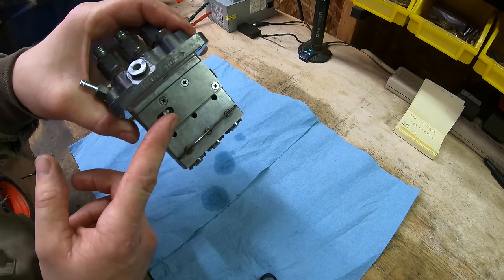When reinstalling the pump, the stop lever on the rack must engage through the notch in the solenoid bracket. The pump needs to be held down against the spring pressure of the lifters while starting the back nuts first, then the front bolts. When pushed down firmly the pump sits flush with the block — that's confirmation it's seated. The bolts are snugged to the same feel as when removed.